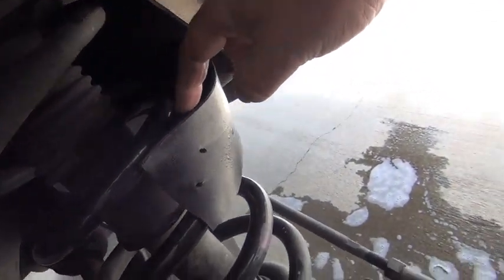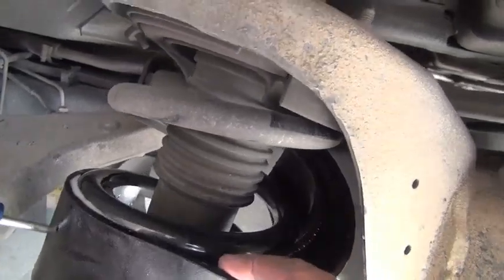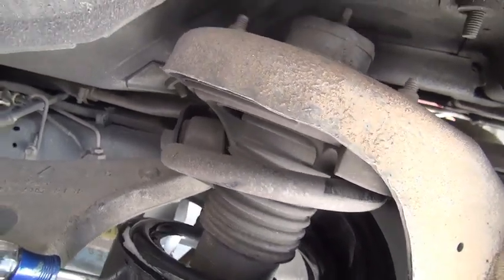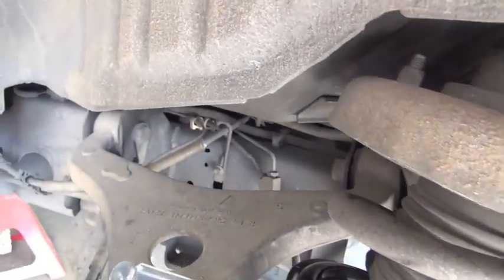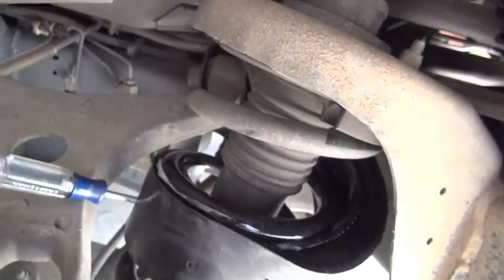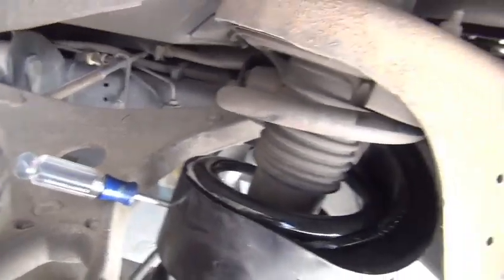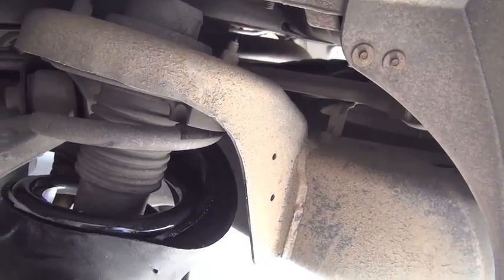I've got about an inch of it started in here and it's in the bottom fairly well. You can see the grooves and it's installed all the way around here. I'll leave it recording so you can see how I'm doing this. The toughest part is getting it on for the first two inches — after that it goes pretty easy. When you drop the axle that extra bit, you take most of the stress out and open up those coil springs.